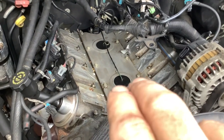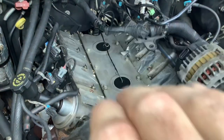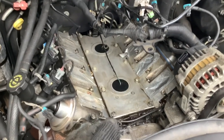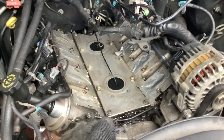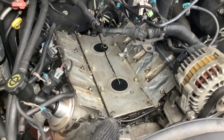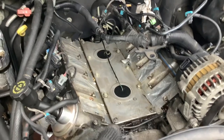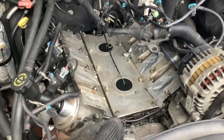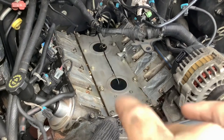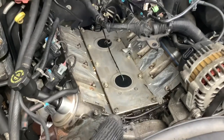There are foam boots on both ends of the intake that are supposed to prevent water and moisture from getting into the knock sensors. Mine look good, so I'm going to leave them alone. I could replace them and then 200 miles later throw a check engine code even with ACDelco or aftermarket sensors. It's 235,000 miles on this vehicle and I'm not getting any code there — I'm not even going to pull them, because there's a possibility of breaking the electrical connection. If I have to pull the intake again to replace the knock sensors, then that's just what I'll do.